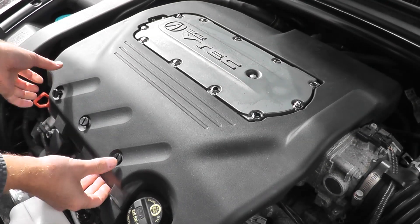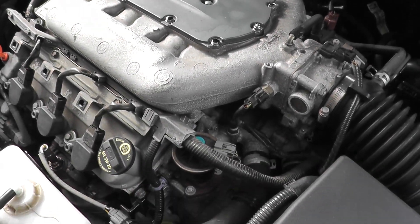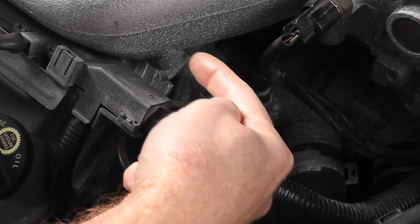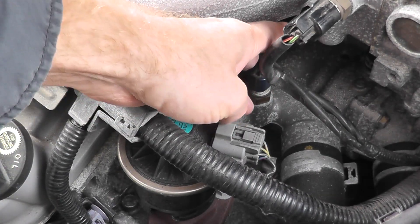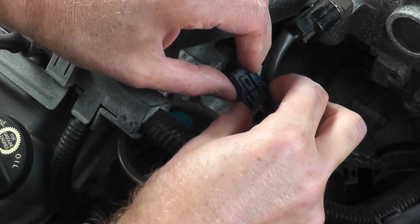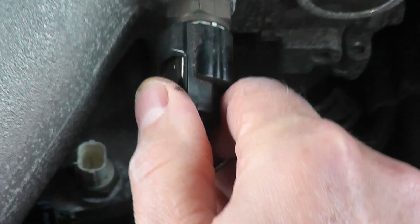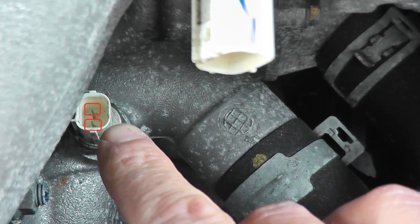These are just flat head fasteners with rubber grommets in the back. Right here is where the sensor is located. We can test this sensor while it's still attached to the vehicle. On the harness connector at the nine o'clock position, there's a little tab — press in that tab, pull on the body (don't pull on the wiring). Taking a look inside the sensor, there are two prongs. We're going to hook this up to a multimeter and take a reading.